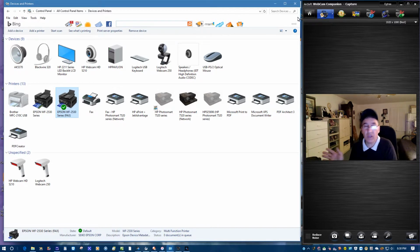But please, if you get the printer, if you don't have time the same day, I mean, if you're at work, it's a different story, then the next day, please work with it. Make sure you've got your cartridges, put fresh ink cartridges in there. The other thing I want to say is when you put ink cartridges in, you might have to do an alignment test on it, and you might have to perform the clean printer cartridge test to prime them up and get it to work.